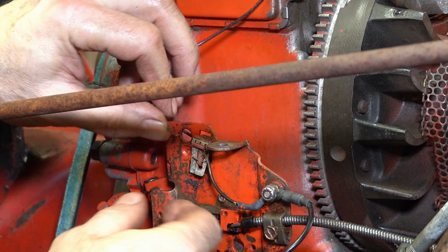This is aiming right at my hand for the adjustment, but I guess part of the idea is to maybe put heat over in that area. It's definitely not adjusted properly, so we need to figure out why it's out of adjustment. It's not hitting idle. But it runs strong, right? It started right up. Okay, so now this wire here, it's got to be grounded. So I connected this to ground. We should be able to kill it properly without having to choke it.